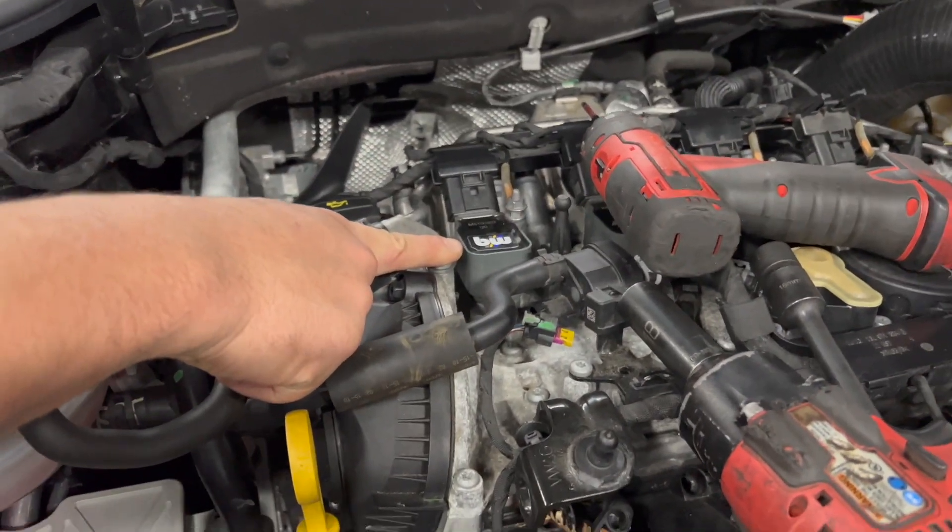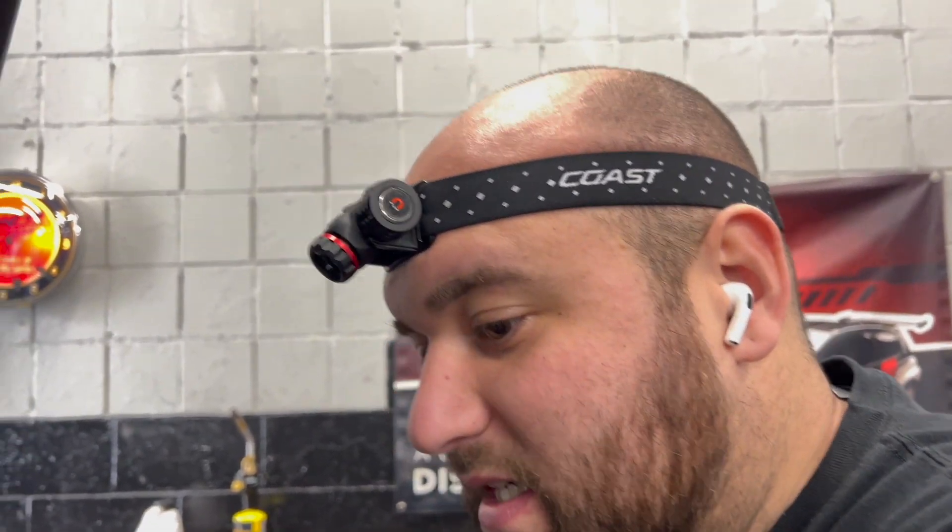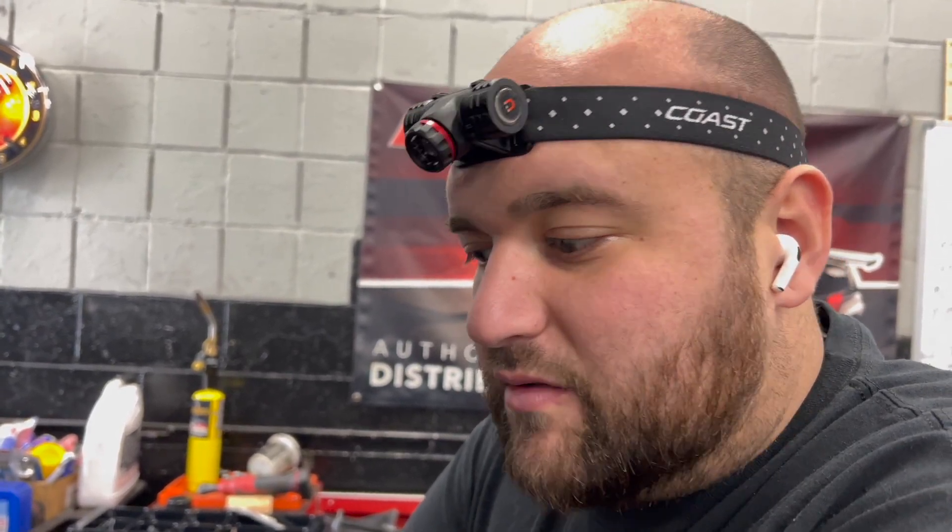In order to get to that, it's stuffed all the way down there — you can't even see them in there. They're way down in here. This is probably the easiest one to get to, but still you've got to take the wheels off, fender liners have to come off, the wing's got to come off, the rear bumper assembly has to come off, and then we essentially work our way from the back towards the front. Then we'll be replacing the tip down there too.